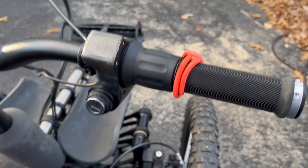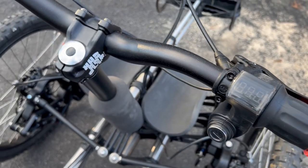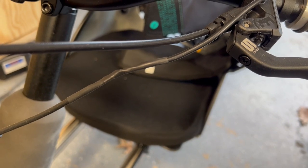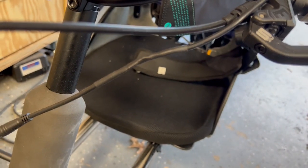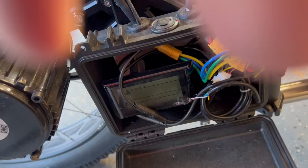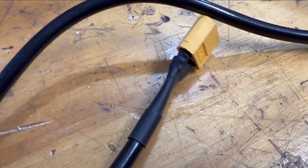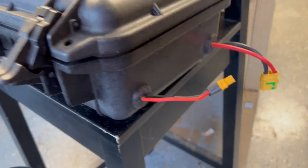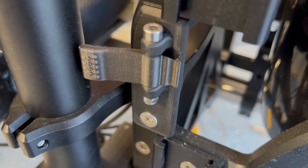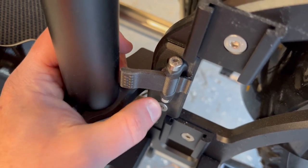Another quality of life improvement would be some sort of parking brake. I'm just using a bungee cord to hold the bike still while I get in and out of it, or if I'm on a hill and just want to take a break. The mechanical design of the bike is excellent, but some of the wiring and electronics is a little amateurish. The wire that goes to the up and down buttons just has this flimsy splice with some shrink tube over it — I don't know why they couldn't just put the right connector on it so that it would connect into their wiring harness. The motor controller is also kind of a rat's nest. There's a lot of extra wires and connectors in here, and there are just RC car connectors or hobbyist-grade connectors for the battery. The Bowhead uses some 3D printed materials, and I don't have a problem when they're used to just seal out the battery wires, but the entire battery latching mechanism is a 3D printed assembly. On a production piece of equipment, I don't think it's really appropriate to be using 3D printed parts here.